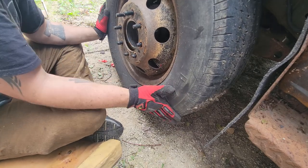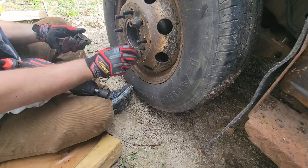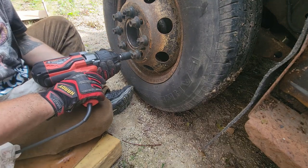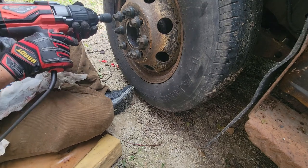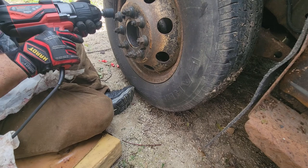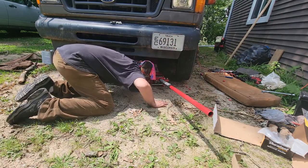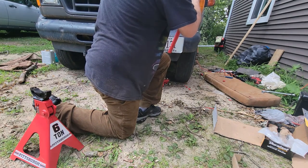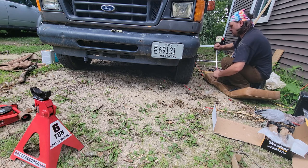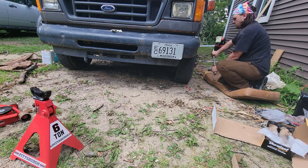If you've never changed a tire before, when you're putting a tire back on, you always want to screw the lug nuts on in a star pattern. You start from one side and skip every other bolt — I always do it like 12, 6, 9, and 3, and then do the middle ones. This is going to keep the tire going on straight and keep it from wobbling. That is very important. I'm using the impact wrench just to get it up nice and snug to the tire. Then you're going to want to lower your vehicle slowly — you don't want to just drop it, as that's not good for any of the parts your vehicle sits on. Go through and tighten the lug nuts, give them one more turn to the right, and make sure they are nice and tight and not going to slide off while you're driving.